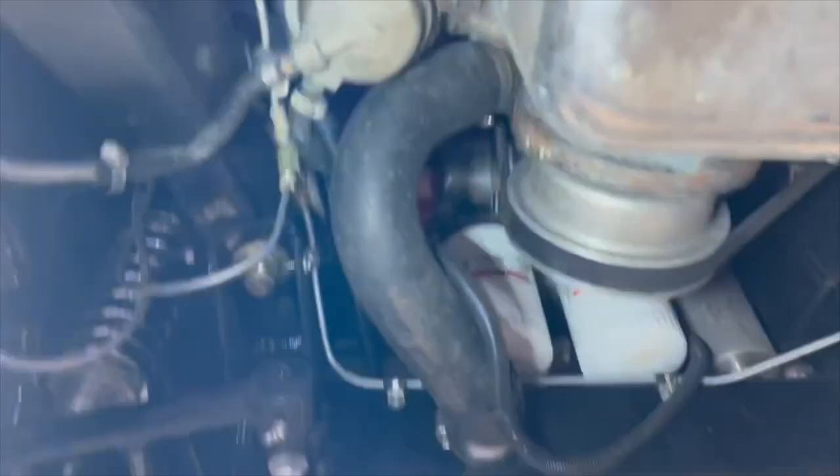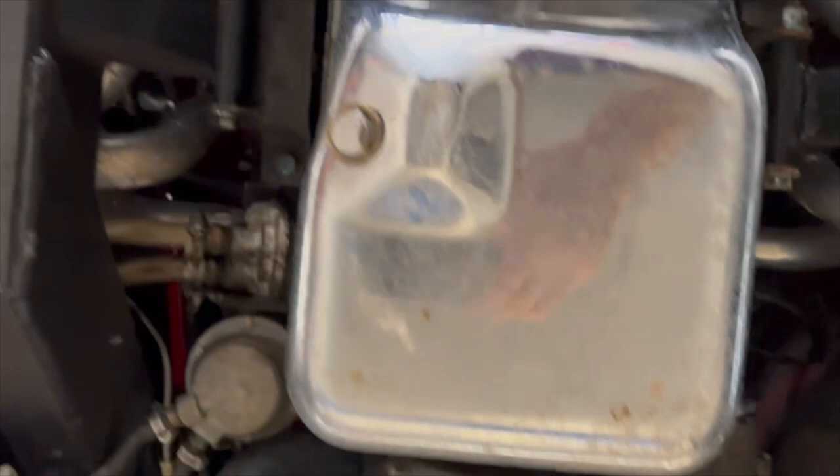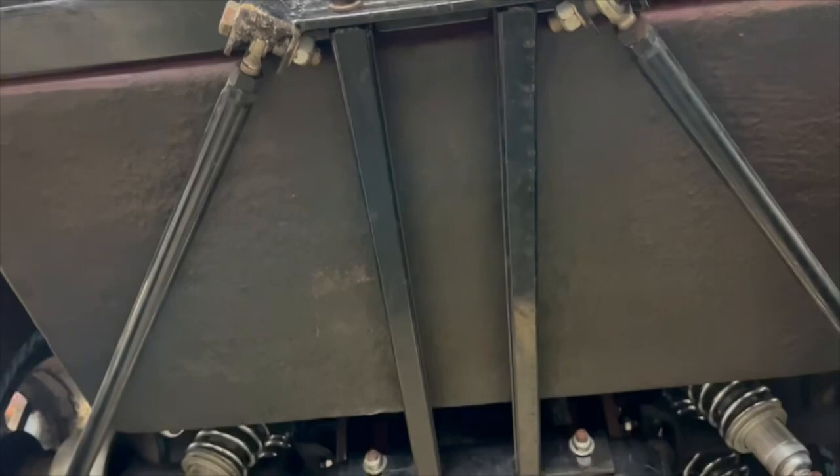As we go under the car, you can see a lot of this beautiful work underneath here. It is a totally powder-coated, nice frame. It has a Tremec HD 3550 five-speed manual transmission with a 0.83 overdrive. It has a McLeod clutch, and you can see this safety loop over the drive shaft. These cars actually have Jaguar suspension — four-wheel Jaguar narrowed independent suspension. The differential has a 3.31 rear gear in it. You can see that 20-gallon aluminum Harris racing fuel tank with a Le Mans racing fuel cap on top.